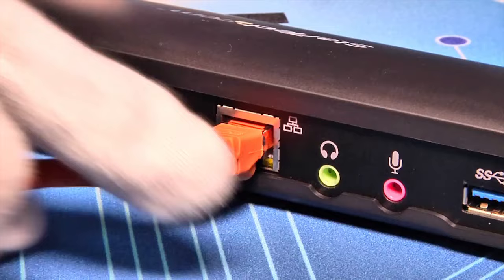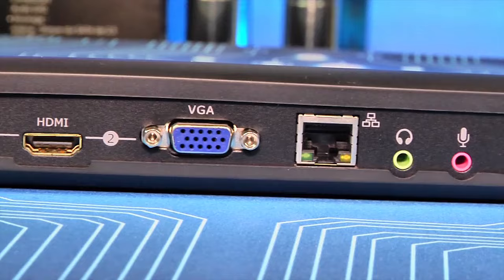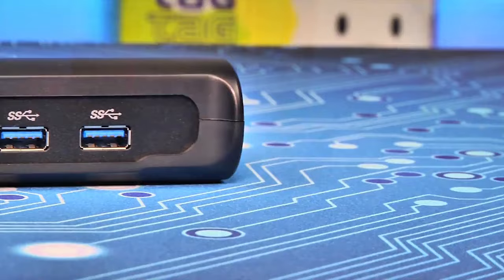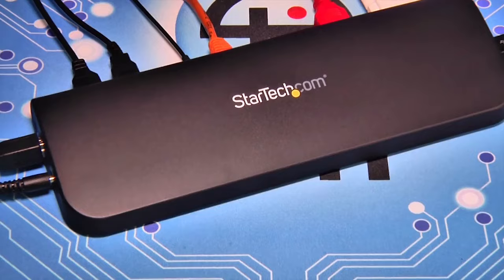Combining a DisplayLink 3900 video chipset with a Realtek 8211E Ethernet adapter and a VLI-810 USB interface, the dock gives you dual displays, gigabit Ethernet, full audio, and a powered USB 3.0 hub, all in a single package. On the back you'll find connectors for DVI, HDMI, and VGA video, a single gigabit Ethernet port, 3.5mm jacks for speakers and microphone, and two USB 3.0 ports. On the right side, StarTech added a third USB 3.0 port, while the left side has a Kensington lock port, the USB uplink, and a jack for 5V power. You can use two video connectors at a time — either HDMI and DVI or HDMI and VGA, but not VGA and DVI — with a maximum resolution of 2048 by 1152 per screen.